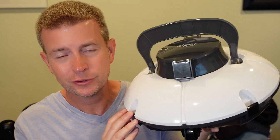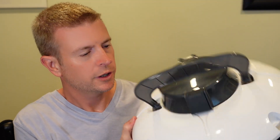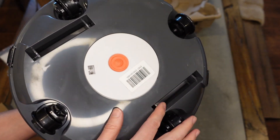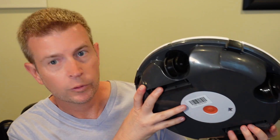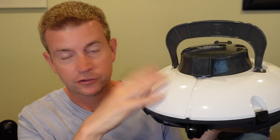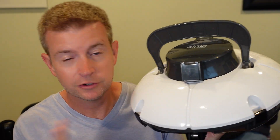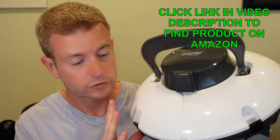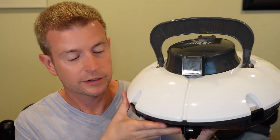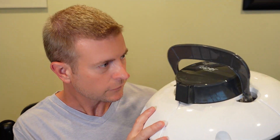It has a screen filter inside so that as it's riding around on the bottom of your pool, it sucks in water through two inlets on the bottom. It has little squeegees that help pick up dirt, which gets sucked up inside. The water flows out and the screen traps the dirt and debris. You unclip these clips to take the top off, and then you've got the screen and the bottom section holding all the dirt to clean out.